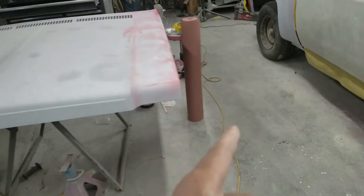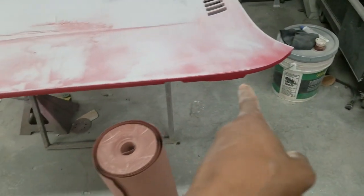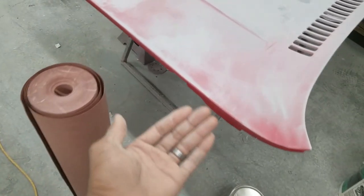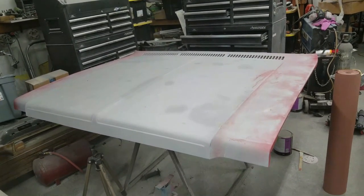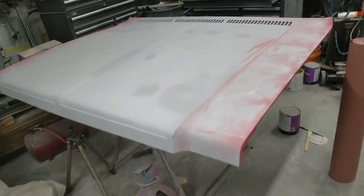There's some red overspray on the hood. Now that I'm looking at this I need to back tape the hood because I've got to put clear on it - I'm painting the hood off the truck. I think I'll just put a curtain down to keep the overspray from traveling up under and getting on the underside of the hood which is already black. Actually now that I think about it, I've got to paint the lower lip of the hood red, and in order to do that I would get red all over the hood that's already black and I don't want to redo that. Yeah, it's always complicated - it's never easy.